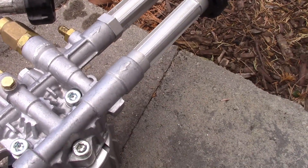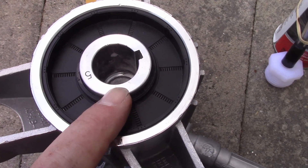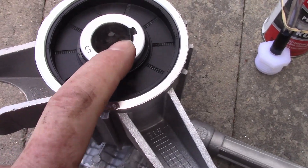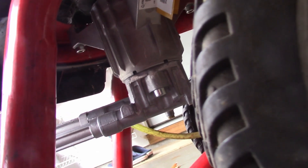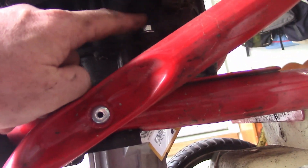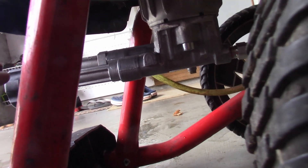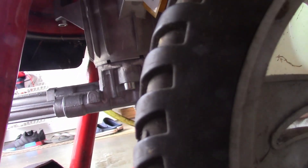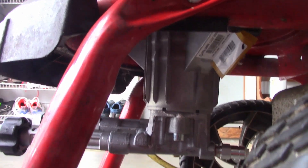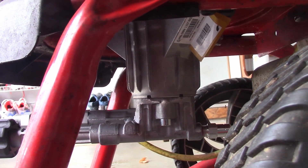Now we'll put the new pump in — essentially just those three bolts again. As I mentioned, it is keyed, so there's a key on the shaft of the motor and you want to line that up. I'll put the motor in first, then spin the pump to align the holes and bolt it down. The nuts are knurled on the bottom so they grip onto the motor and you don't really need to put a wrench on them. Get it tight but don't kill yourself with it, and make sure all three feet are touching and everything is screwed down evenly so it doesn't go crooked. Then we'll get the hoses hooked up, get some water in it, and do an operational test.